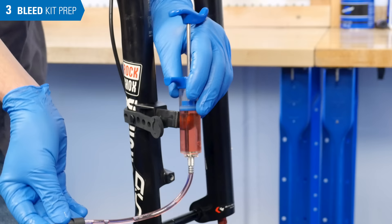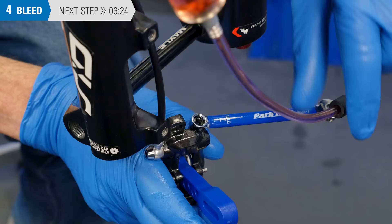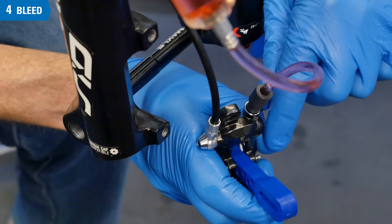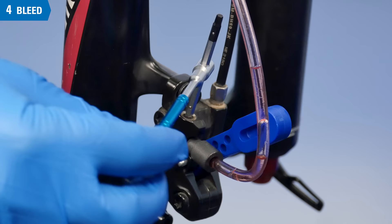Now slowly and carefully push the plunger until the fluid just comes to the end of the tubing. Place the syringe into the syringe holder. Place a 7mm box end over the nipple and push the hose end securely over the nipple. For external nipples, use the compression sleeve to help secure it. Use the wrench to open the nipple one half turn. With calipers with the bleed screw, loosen the bleed port screw one half turn.